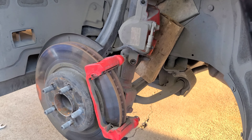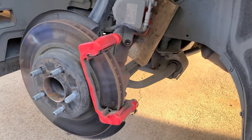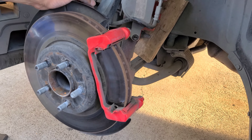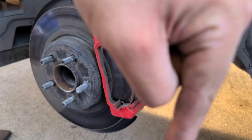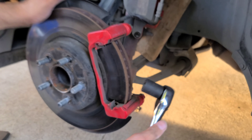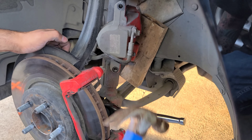When you don't have room for your impact wrench or breaker bar, we're going to show you a technique using your ratchet — but I don't recommend it. Disclaimer: you could actually damage the ratchet, yourself, or parts in the car. Do this at your own risk. I'm using a 13/16 socket with a half-inch drive wrench. Make sure you get it from the back of the head so you won't put too much pressure — put your hand there so it won't come out.